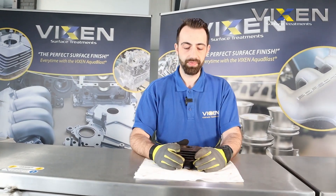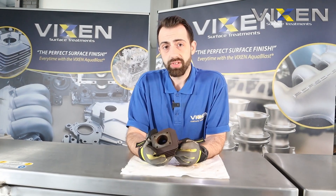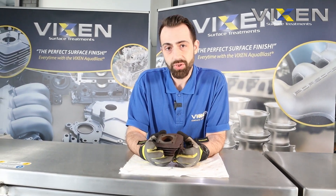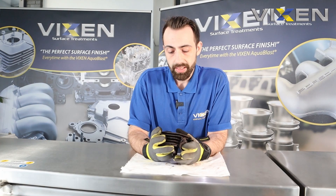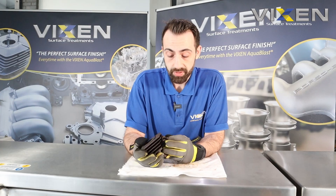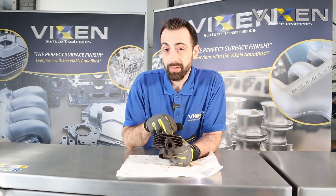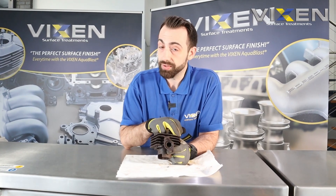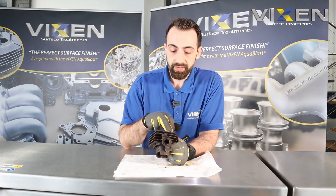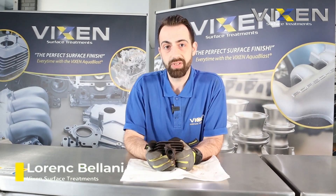Some people will have you believe that this is rusted, and I agree with them - it is rusted. What we're going to do is use our 915 machine to get it cleaned. In the 915 right now we've got the 100 to 200 micron glass beads. I'll be honest, I don't think they're going to be strong enough to penetrate through the water and actually get rid of the rust or the dirt, but we're going to give them a try. If that doesn't work, we'll move on to another media, which would most likely be the ceramic beads.